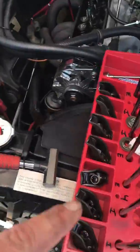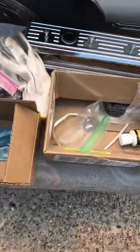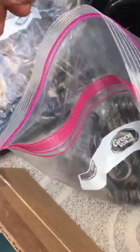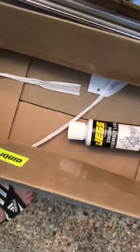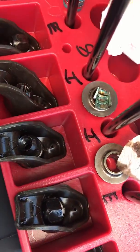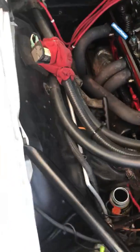These are the old pushrods and rocker arms. Over here I've got new Elgin pushrods, new Elgin springs, and 16 shims — so I've got to pull them all off. I like to put a little engine assembly lube on the locks and keepers when you put that stuff in there and put it back, and then a little bit on the pushrods too — make sure she's all lubricated.